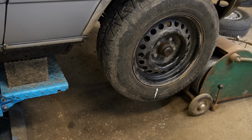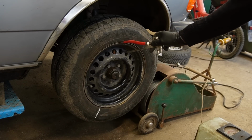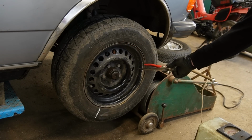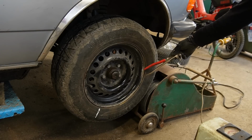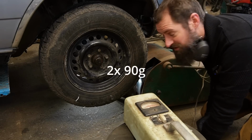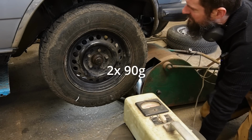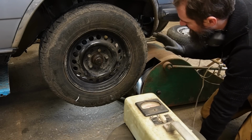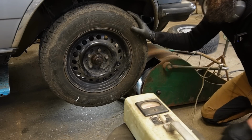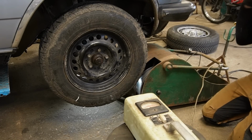That's around 184 grams. And then I need to add those weights on what is the top of the pickup point, and the pickup point is over here, so it needs to be there and there. I gotta say, the amount of weight needed makes me think that maybe I got the static a little bit wrong. I am still learning, but let's see. Ideally, we won't see a lot of flashing, and we will see a measurement within the green if everything's all right. So let's try.